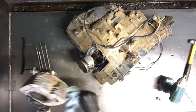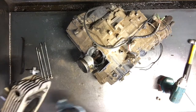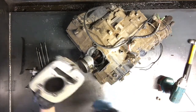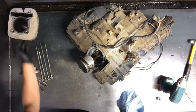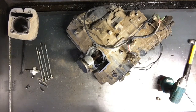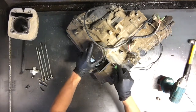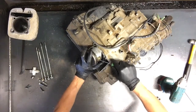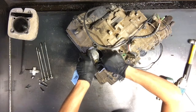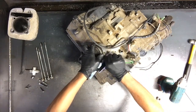Pull that off there and the cylinder is actually in really good condition. Take and wipe it out, just kind of check for scoring, if there's any kind of grooves. Then we'll check with measuring tools on the roundness of it. Now to pull the piston off, we use an angled pick here, and just grab one side of that circlip, come in from the side, and I put my finger over top of it so the circlip doesn't go flying and also doesn't go down into the crank case.